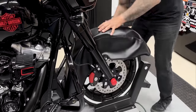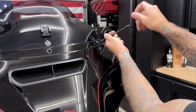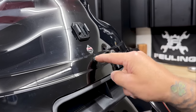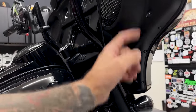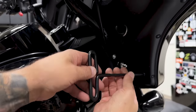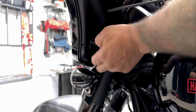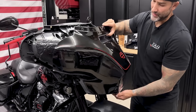Before removing anything, cover up the front fender. To remove the front fairing, you have three screws — they're T27 Torx. You'll have two short screws on the outside and the center one is always longer. I like to put the center screw back in to support the outer fairing when removing the other screws. Remove the two Torx screws on each side — one longer, one shorter, same T27. Then remove the center windshield screw, take out the windshield, and disconnect the headlight from the back.